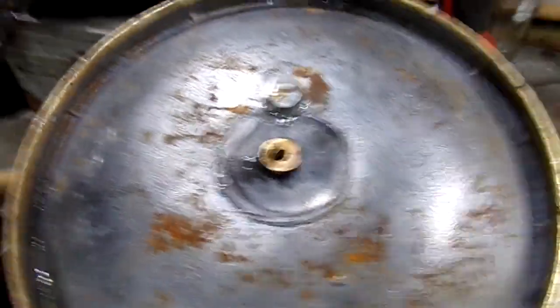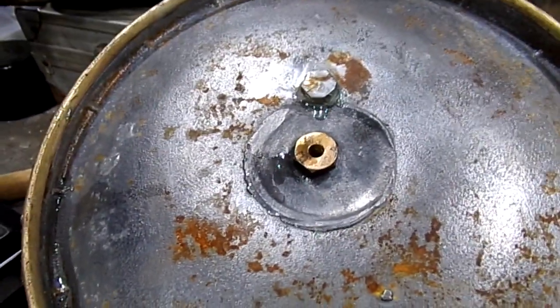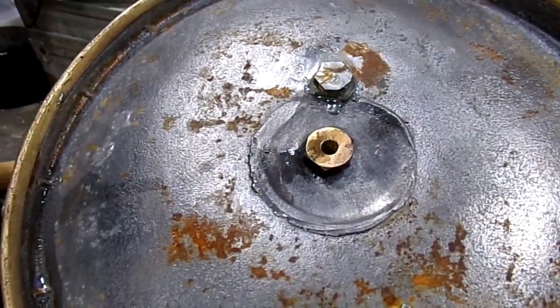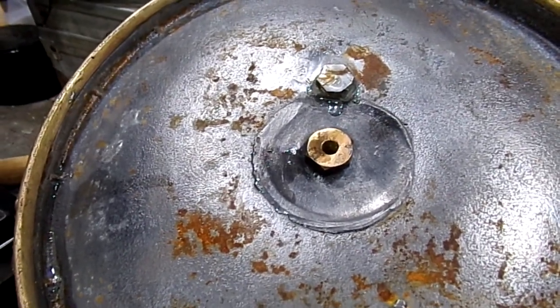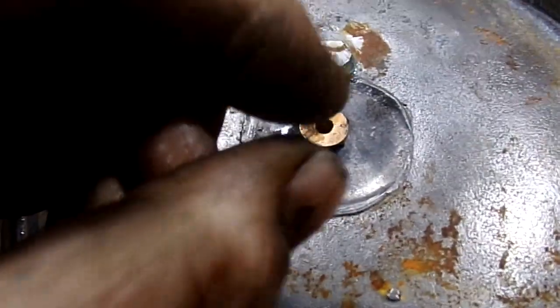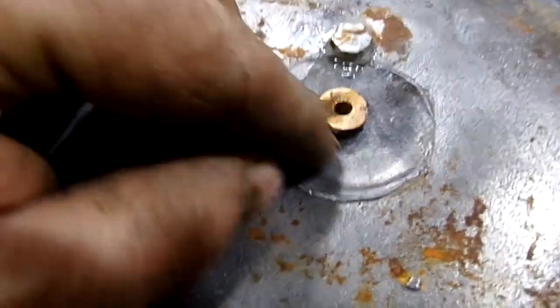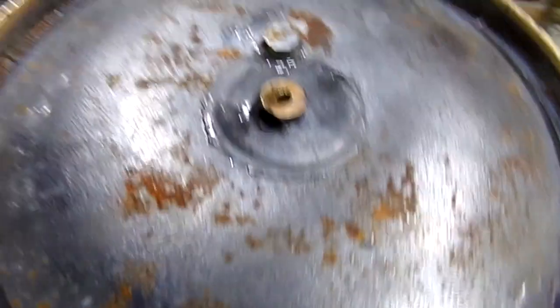But to get a good seal, I think you know I use that OD94, which is a tinning flux. Makes solder stick like crazy. I'm going to tin up the screw or the bolt and then coat it with solder. So that actually makes the screw bigger than the hole that it's going to thread into. So I'll thread it in.